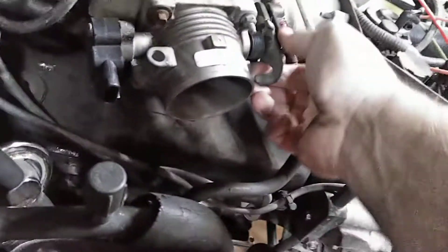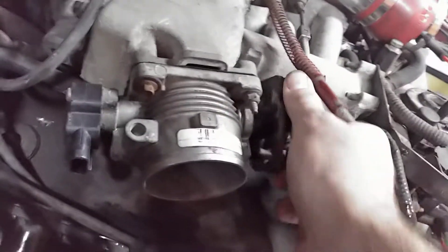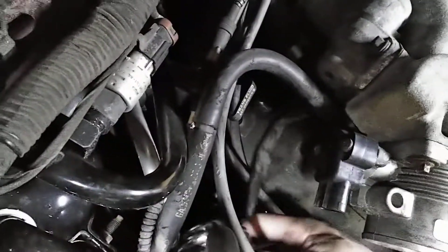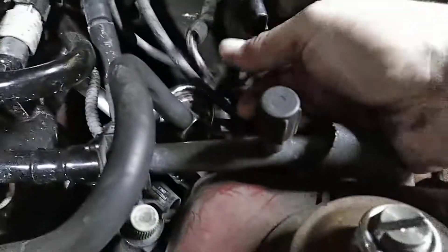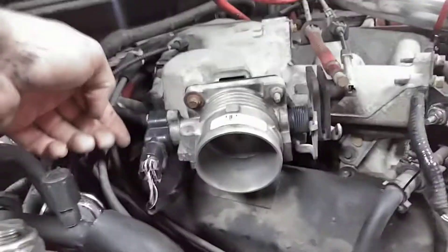So it's all in there and just to show I'm not bullshitting you — nothing hits over here at all, literally opens up all the way. And your throttle position sensor — all you've got to do is take that and plug it in. Now you've got a two-valve GT throttle body on your car and it all fits just fine.